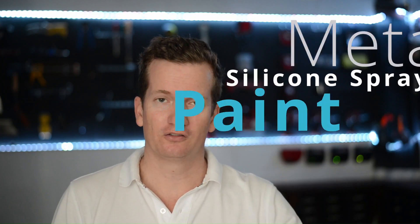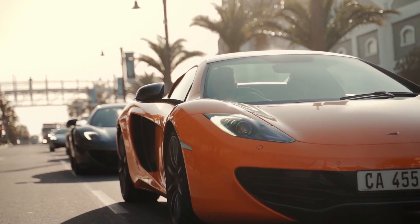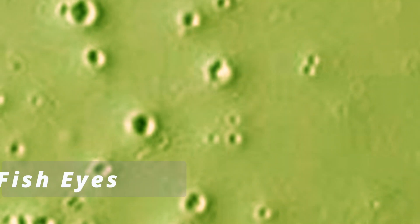The one scenario where you really should not use silicone spray is when you have the triple combination of metal, paint, and silicone spray. Applying silicone to a painted metal — say like a car — would mean that different parts of the paint would be exposed to the elements at different levels, causing it to age at a different rate and producing uneven patches. Furthermore, if you spray silicone onto a metal before it is painted, that will be an absolute disaster. Because the silicone can last on a surface up to 15 years, even sanding the surface won't fully remove it, and traces left behind will cause a paint condition known as fish eyes.